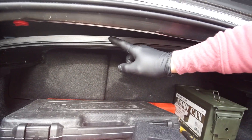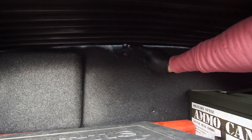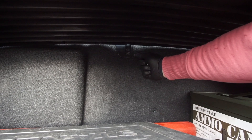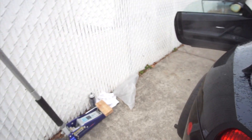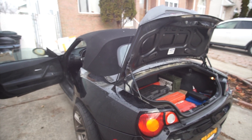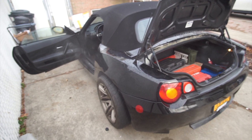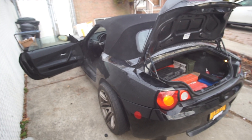To replace this switch it's very easy - you just remove your tray, make sure you take everything out. There are two bolts, one on top and one on the bottom. Once you release those bolts, the bracket slides out. That little sensor cost me about $30, you can get the part on eBay, Amazon, or at the BMW store. I'll put the part number in the description. They tend to break a lot - it's just a little metal hook bracket and they're very fragile.